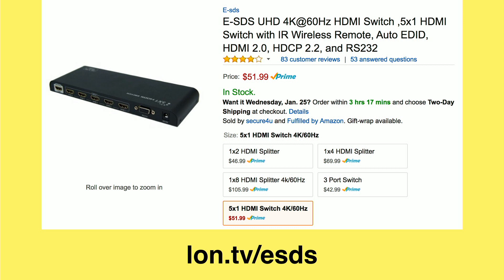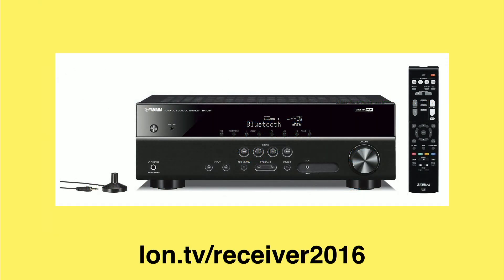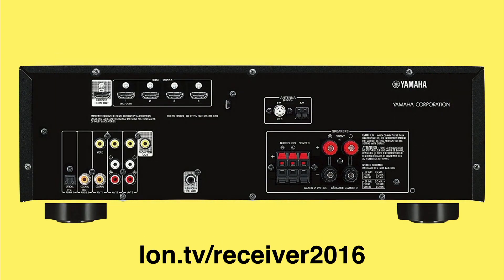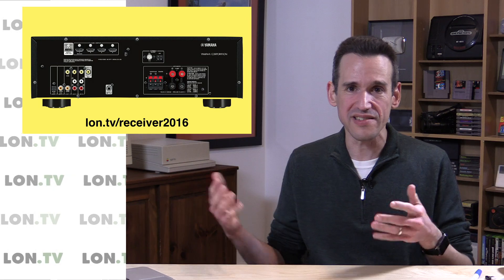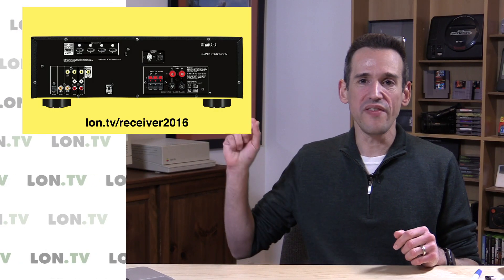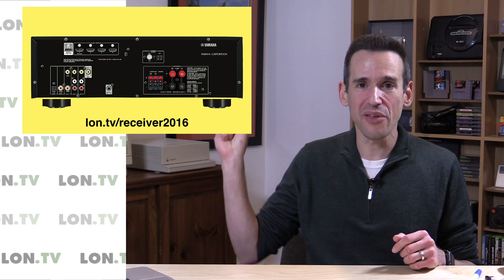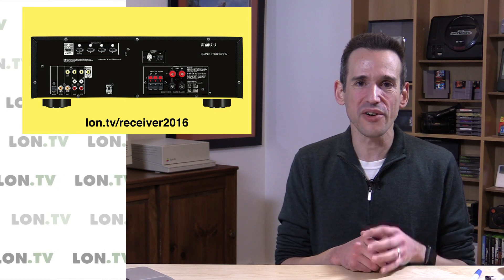I've got a link below to an Amazon affiliate link where you can find that product. What I do here at my house is run everything through my receiver — I talked about this before and I'll link to my mini-review in the video master playlist. My receiver has four inputs, supports HDCP 2.2, and does 4K at 60 frames per second. Everything I plug into it works, and I still get all my audio formats piped through it just fine. And one thing I might do if I start running out of HDMI ports is run the ARC port out of my television back into it, picking up two more ports while still getting digital audio delivered to the receiver.